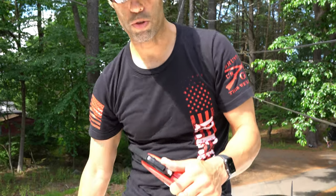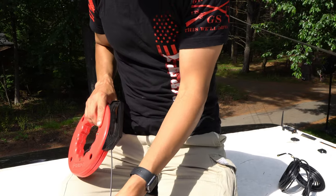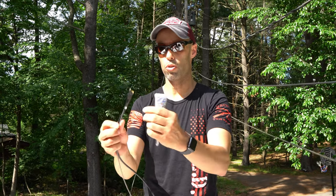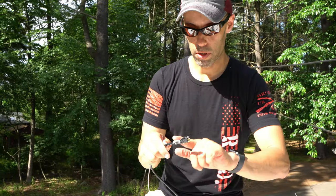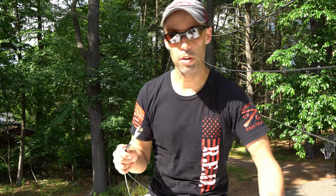What I plan on doing first is running this wire fishing tool — this is what electricians use to run wiring through walls and tight areas. I'm going to run this through the conduit and make sure it comes out in the front cabinet. If it does, I know I'm good to go. Then I'll mount the plate again, drill the one and a quarter inch hole into the plate, and mount the antenna on top running all the wiring through. Just a little secret for fishing: black tape the cable around the fishing tool, do one cable at a time, and put a little lithium grease on it to lubricate it going down. MJ is going below, and when she sees it coming through she'll pull the wire through, then we'll repeat until all wires are through.